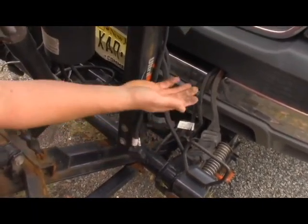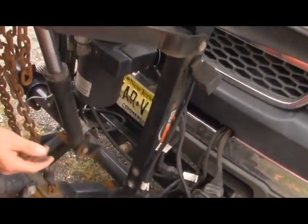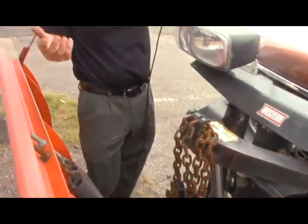It has a dust cover on the vehicle side, and you can put it into one of these ports over here just to keep the dust out. You want to use dielectric grease to keep the moisture out of those connectors, and it will make the life of those connectors a little bit longer.